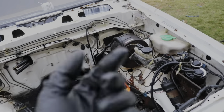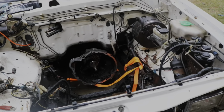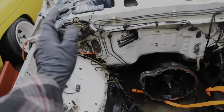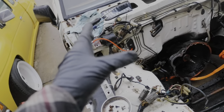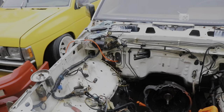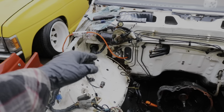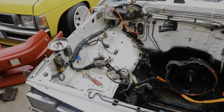If you have no engine in it, it's a lot easier. But if you do, just unplug everything that goes to the engine — distributor wires, ignition coil wires, your choke wires for the carburetor, simple stuff like that, and grounds obviously. As you can see, it all comes out of the firewall over here, so we're going to try to keep it as close to the stock location as possible, just outside of the engine bay.